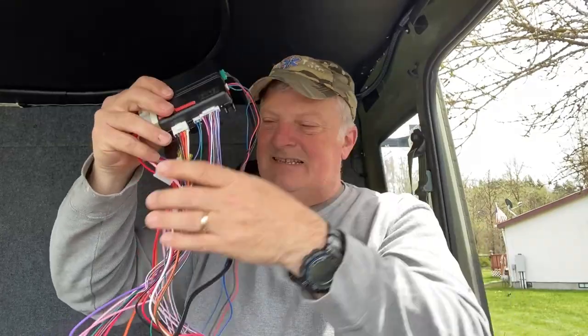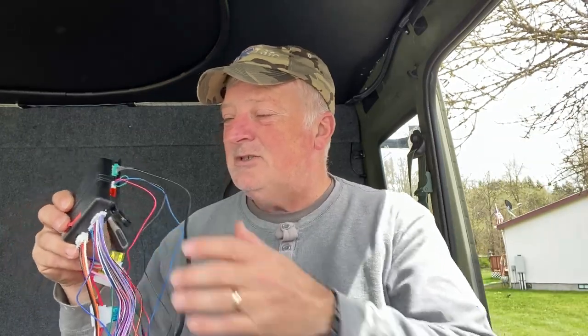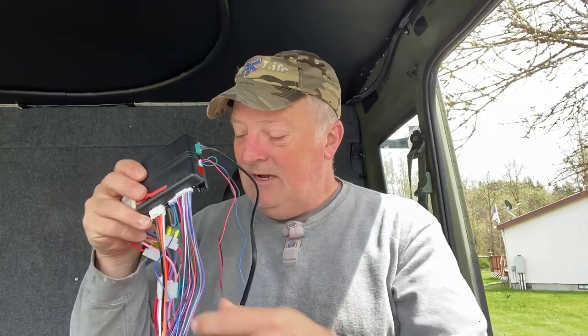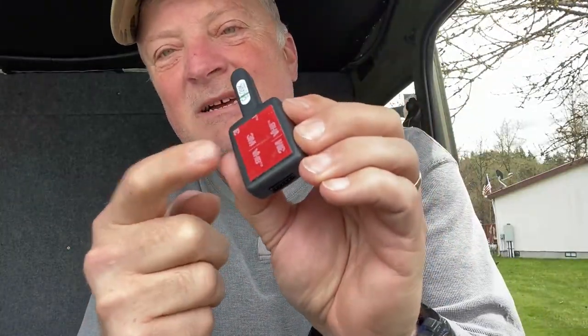One of the very first things I'm going to do is make sure I have all of the parts that came with this, and then I'm going to plug everything in. I'm not going to need everything — because I don't have power windows or power locks — but you may want to install those later, so I'm going to keep those wires intact. Several things I won't be using I'll just bundle up. The next thing is figuring out where to put all this stuff. This little guy — the program button with the LED — is one of the more important pieces. I want it accessible so I can always push it to program the unit.